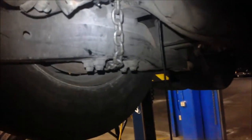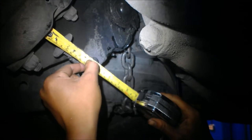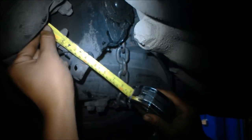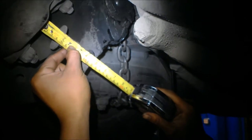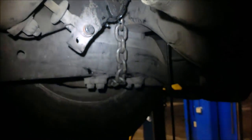Can you apply the brakes? And it moved up to about four inches, so that is about one and a half inches of travel — within specs.